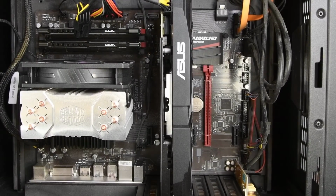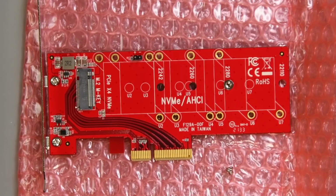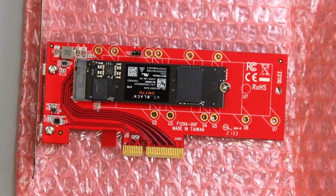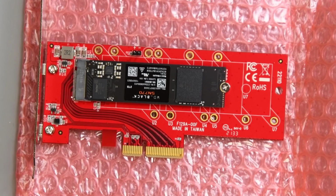I will admit, I was looking at some B550 motherboards that had 2 M.2 slots on them. Would be a lot faster storage interface. The price is not too bad, but still around $150, and it's kind of at a dead end. As it is, I spent a little over $100 and got fast enough storage. And this SSD can carry over to a new platform. I'm kind of hoping this will hold me over till I can move to a DDR5, AM5 platform. As long as this B350 motherboard doesn't conk out on me, that's the plan.